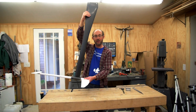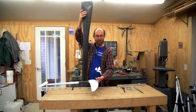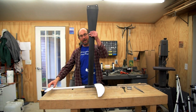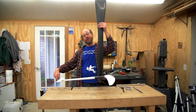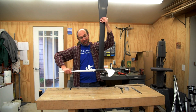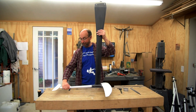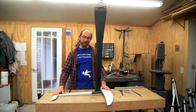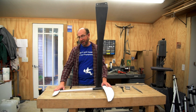What's pushing it forward is all up here, and that pitches the foil down like this. So the role of the stabilizer is to actually counteract that pitching force. The stabilizer pushes down opposite to the force of the wing — it actually creates a lever that prevents the foil from pitching forward. And this angle is very important in controlling the way that the hydrofoil rides.